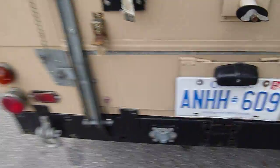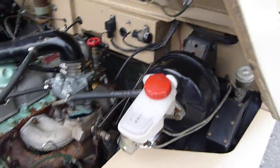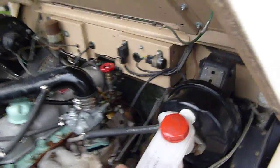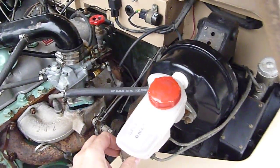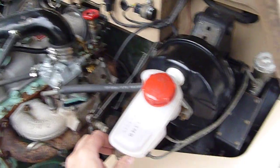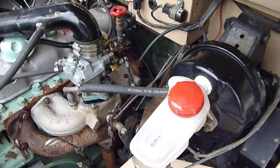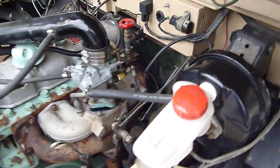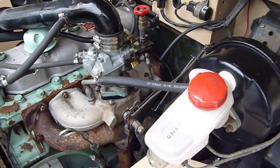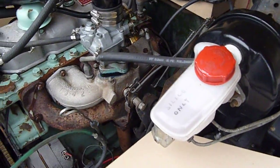I've also added provisions here for trailering. Let's talk about the brakes. I redid all the brakes — replaced the master cylinder and the soft rubber lines, some of the hard lines in the rear, and all the rubber seals inside the brakes. Since day one I converted it all to silicone. Silicone is better because it doesn't absorb moisture, and when your brakes get up to temperature it won't boil. If there is moisture and you get air bubbles, that's when you get a soft, spongy brake pedal.